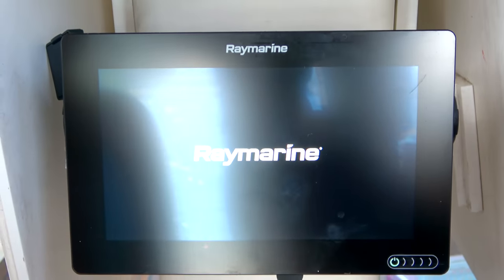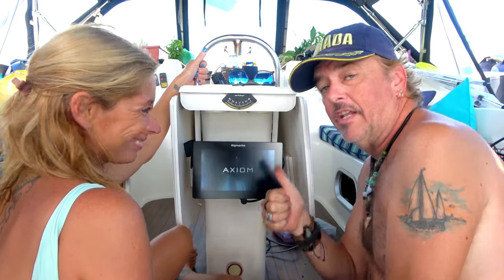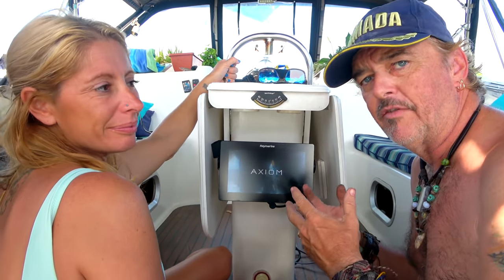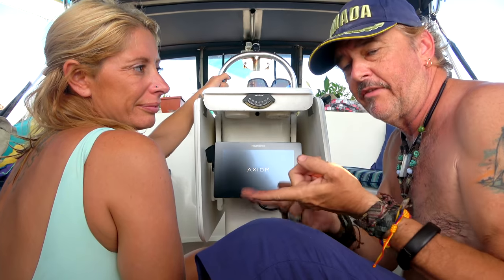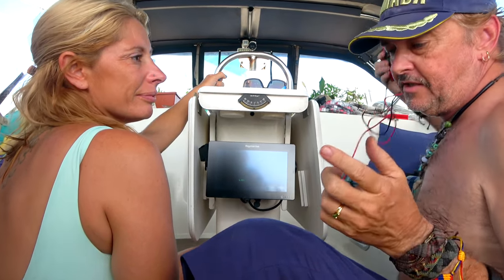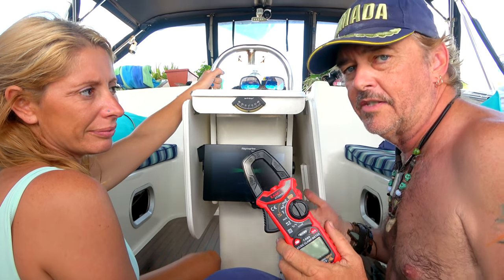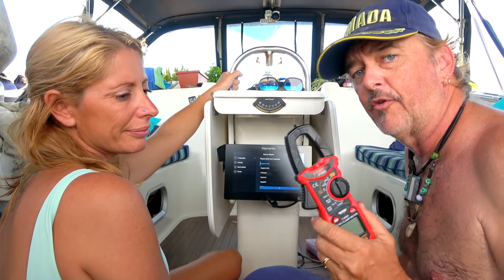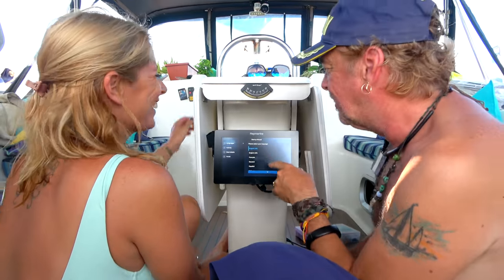Touch the screen, swipe it to the right — the green light turned on. Axiom, we have power, we're in business! And it seriously was that easy. I don't want you guys to get intimidated — we're not going to do everything perfect right now, but we're going to walk you through the basic steps of what to look for and how to hook things up. The important thing is to make sure you don't mix up your power connections, because you can damage things by having the positive and negative reversed. That's why a multimeter is one of your most important elements — if previous owners have used random wire colors, check it before plugging in your expensive electronic device.